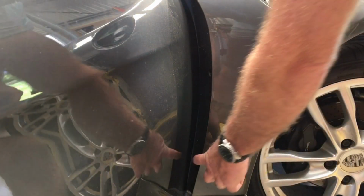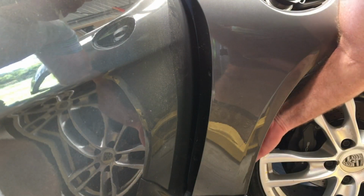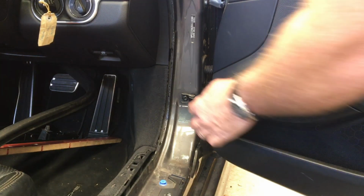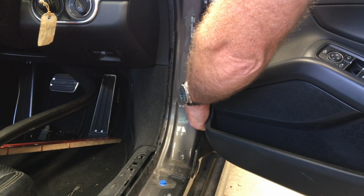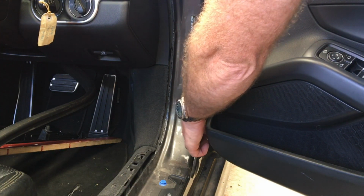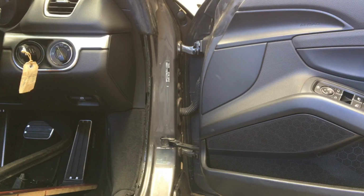And once you've pushed the stem out rearwards, grab hold of it from the other side, and then get the rivet and push it out from the front here, and grab hold of it on this side. And to allow me to open the door a little bit more, I'm going to remove this screw here, and I'll be able to open it probably another 10 degrees or so. There's some stops here on the hinges that won't let it go too far, but that'll open up a little bit more in here to allow us to get that out.